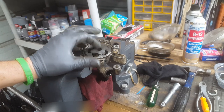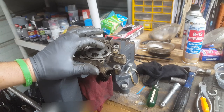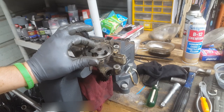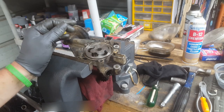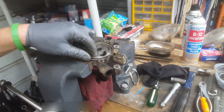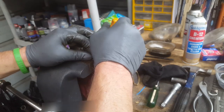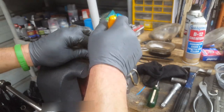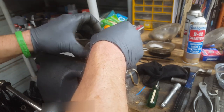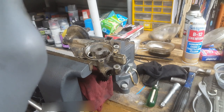The oil was not all going out of the pump. You know, it was bleeding, I would say, through all these grooves. Now, that's just an idea, but I did look at this somewhere on one of these rotors. I'm not sure I showed you that, but to finish that thought, it's worn out. It definitely is worn out. It was only really worn out measurably in one area, but there was a spot in here.